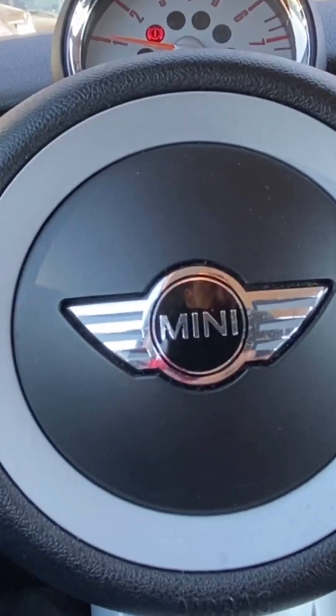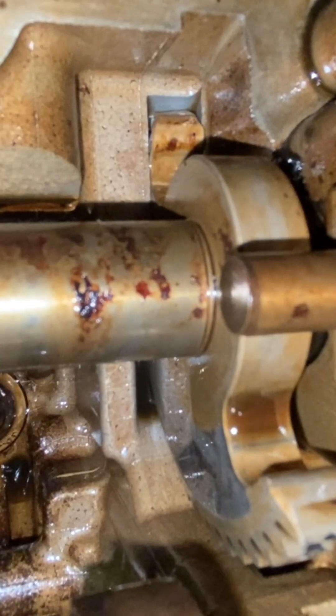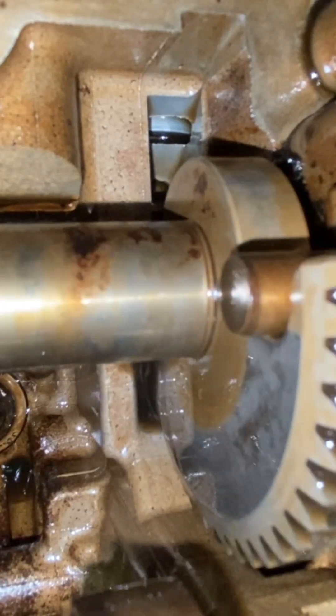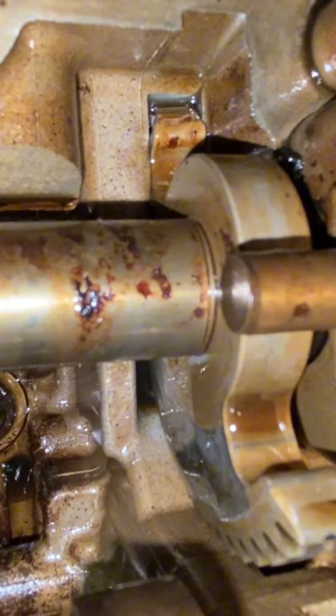As you can see, without Valvetronic engaged there's no misfiring — it runs great. Misfiring on cylinder four was Valvetronic all along — you never would have believed it. And just to finish off, this is what the eccentric shaft receiving part looks like — the bit the motor meshes into. As you can see it's not in great condition. That's exactly the main reason why Valvetronics fail on these. There's a special grease you can put in there which almost no one ever applies when they replace things, so it wears out and everything starts to go haywire.